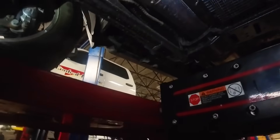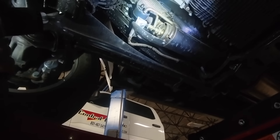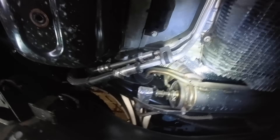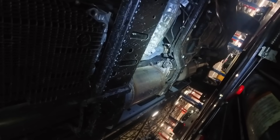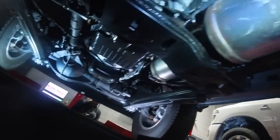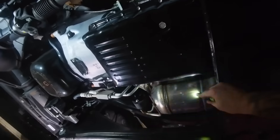Some noticeable differences under here. Starting at the front at the exhaust, right there is a DEF injector, which means the SCR is before the DPF. On the 2024, the DPF and DOC are a combined unit. On the 2025, we have the DOC as part of the downpipe into the SCR, and then over into the DPF. Over on the other truck, the DOC and DPF are in the same unit — DOC on one side, DPF on the other — and then the SCR is behind it. Totally different setup.